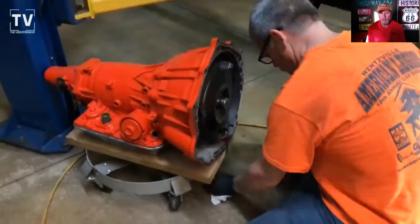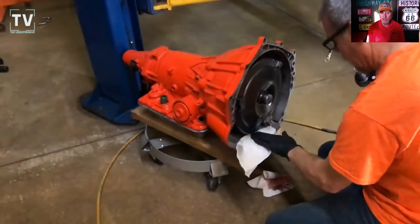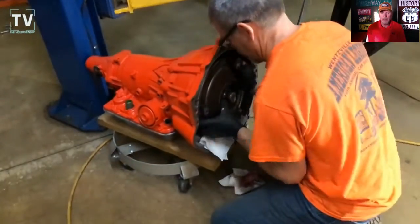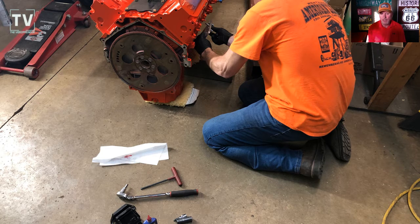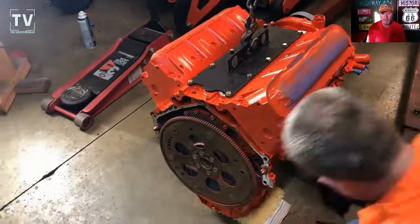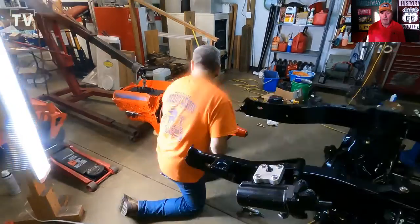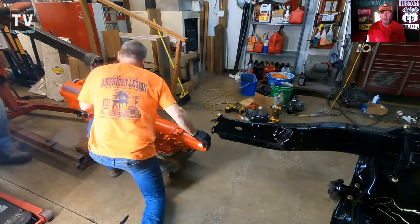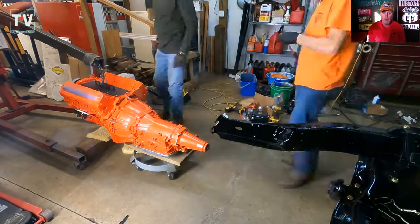If you look at the rim or the perimeter of the transmission, you see it doesn't have paint on it. He was telling me that a lot of guys paint that, and a lot of guys paint the lip of the engine — you can't do that because of electronics. What you see Lynn doing right now is he's trying to seat the torque converter properly, pushing on it until it drops into place. You really have to finagle it because you think it's in place but it might still be a little loose. You want to make sure it's seated properly because if it's wrong you'll find out the hard way and it causes a lot of damage.